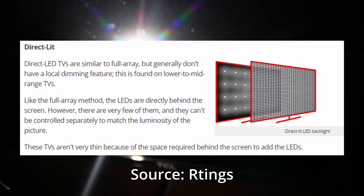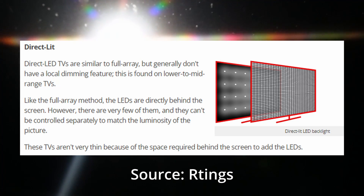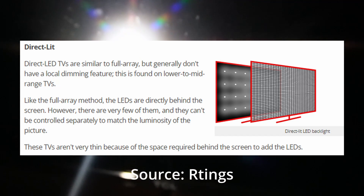And nothing. The TV turns on, but I can't see anything on the screen. Holding a flashlight up to the screen reveals that the LCD is still working — it's a little dirty, but here you can see the Smart TV's home menu. I can also see a clock icon on the screen. This means that the TV's backlight is not working. LED TVs like this one have a set of very bright LEDs that get filtered through a few layers of light-diffusing plastic to provide even illumination to the LCD screen.